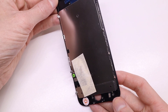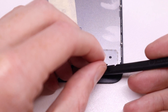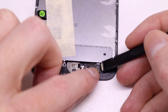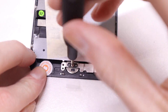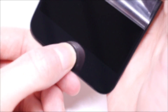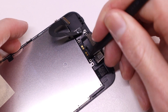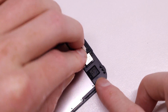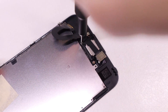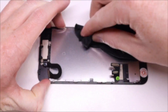I ordered a new display — a refurbished Apple panel — and luckily it actually came with the metal backing plate already installed, so I didn't have to transfer that across from the old one. Now that that's ready to go, I can install the new home button, and sure enough it's clicking correctly. So it's time to reinstall the camera assembly and front-facing flex cable, clipping everything back down, installing the earpiece and screwing its two screws in before putting on the main bracket which holds the front-facing camera in place. After removing the tape and giving it a clean-up, the display is prepped for the iPhone.